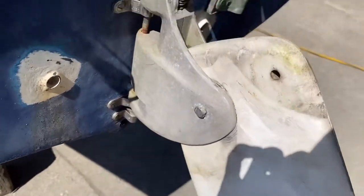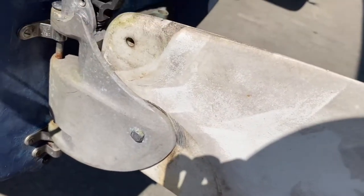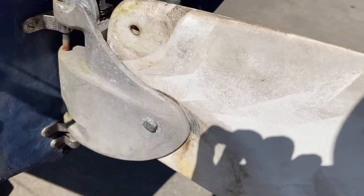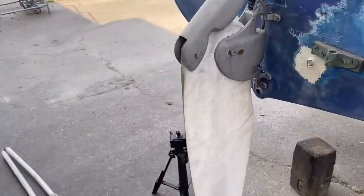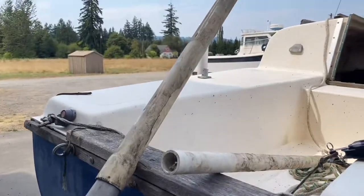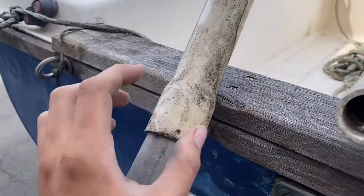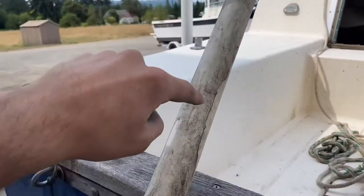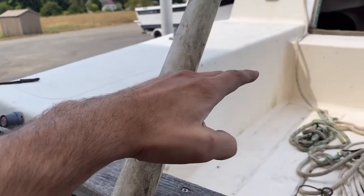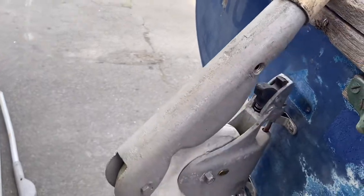I'll pull it up, drill through that same hole making another hole in the actual rudder itself, then you can put the pin in and lock it up as well. It's the next day — got the rudder installed, still got to build the tiller. The tiller handle is coming into action. We got this flared end of the PVC that slips right over, nice and snug. We'll cut it about here, heat it up with a heat gun, bend it over — that's the plan, and it should work perfectly.